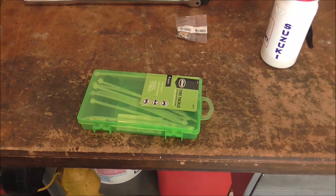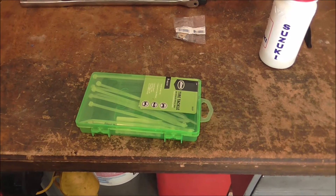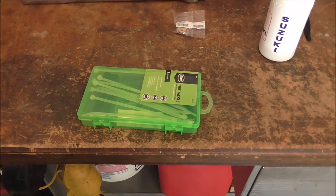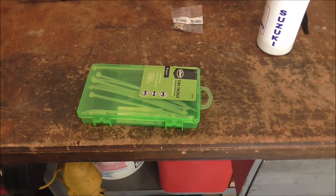Those two things — the pump and the tire plug kit — I would recommend bringing rather than a spare tube if you have the tubeless tire system. That should take care of any common punctures. If the inner high-pressure tube fails, there's no substitute other than changing it or using a standard patch kit on the trail, which I would not want to deal with. But it's unlikely that inner tube would fail.